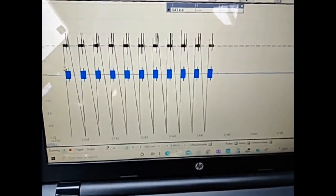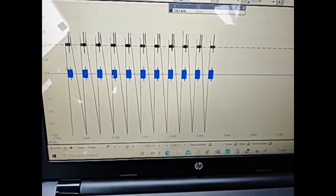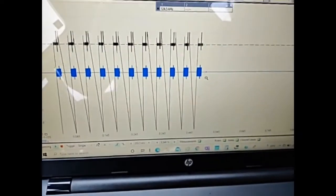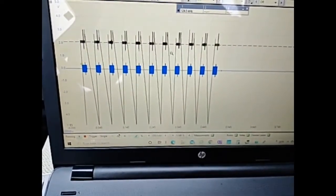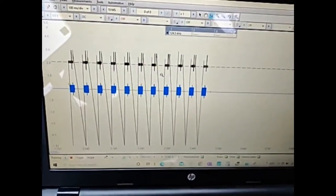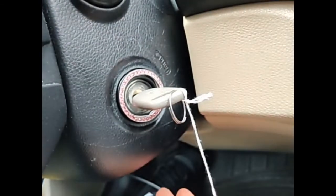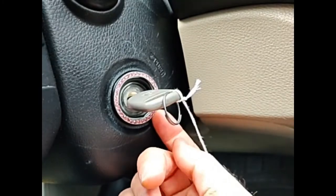Now on the 2013 Accord we're working on, look at how many packets we have: 1, 2, 3, 4, 5, 6, 7, 8, 9, 10, 11. This is really strange and I'm not sure exactly what's going on. The frequency is at 124 kilohertz — 124,000 Hertz. I have a suspicion of what might be going on. If we go back to our status log, A3 indicates possible interference from outside sources, like this metal ring here.